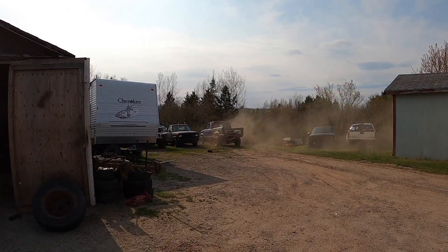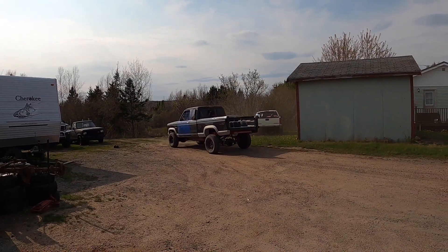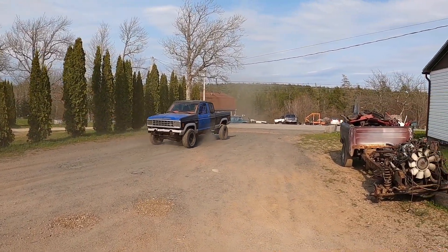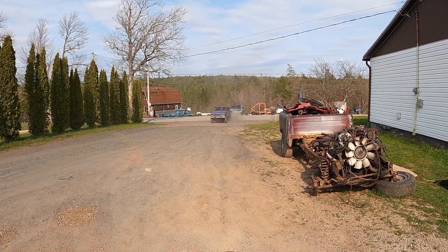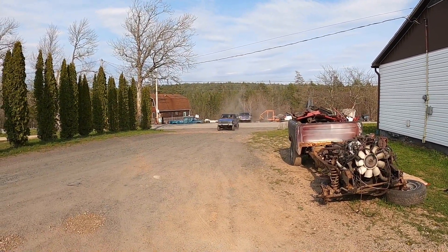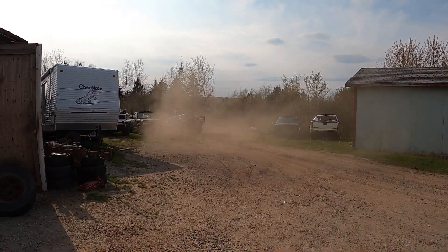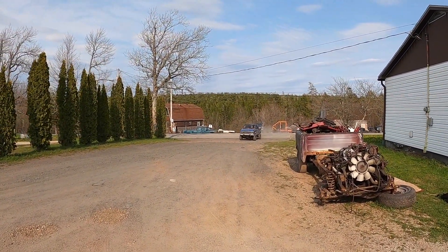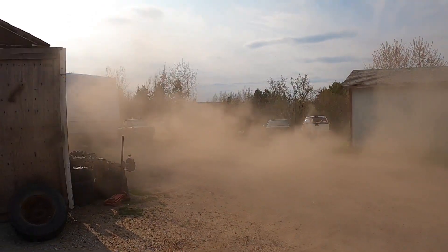The test hit was done and I think she can go even higher than that. We went from 5800 RPM and now we've got it set at 6000 to see how it jumps. The mass airflow sensor was acting up but we've got her working now. It's smile-worthy — looks like it's going to work pretty good.